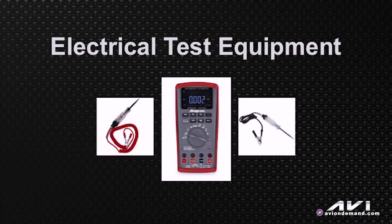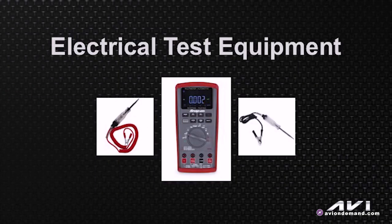On the left-hand side of my screen is the LED test light, which has virtually no loading effect. So in summary: when we use a test light we don't know how much voltage is actually there, but when we use the multimeter we can see the exact voltage supply. However, if you've unplugged a component and are doing an open circuit voltage check, it makes no difference whether you're using a 12-volt incandescent test light, an LED test light, or a digital multimeter — the loading effect is simply not there.